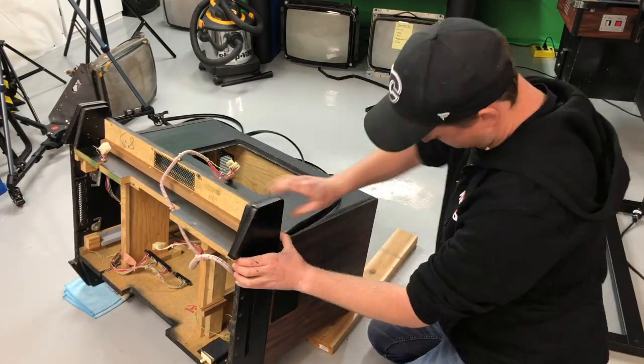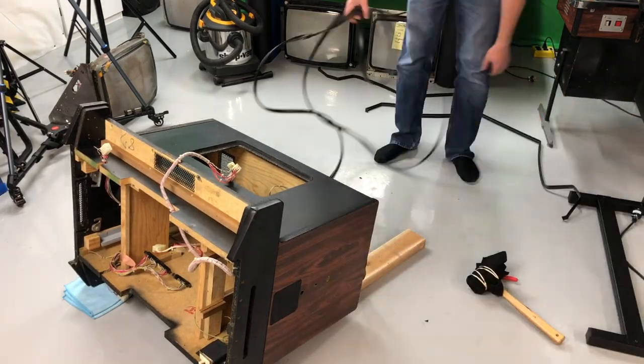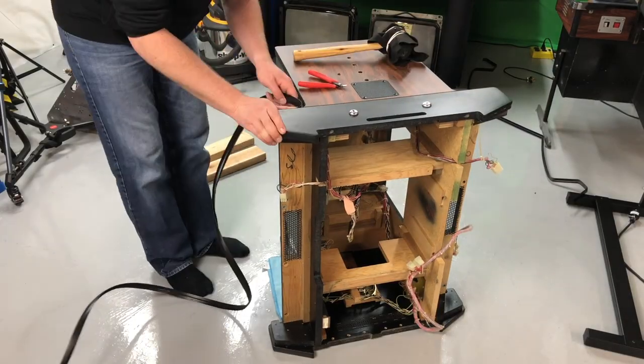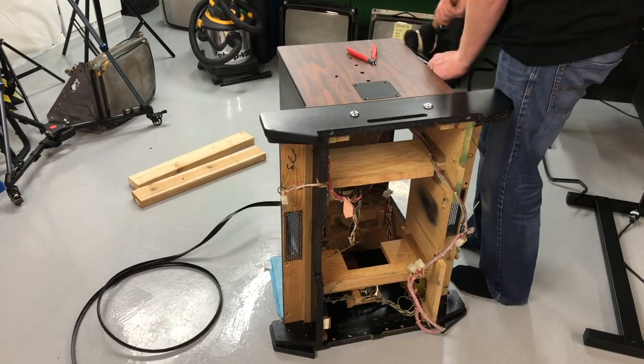Installing this is actually a really simple process. Start on one end, using a staple or a nail to hold it in place if need be, and simply hammer in the molding along the edge. As I mentioned, you'll want to cut the barb of the molding to help set it around corners, and hammer it in with the mallet as you go.